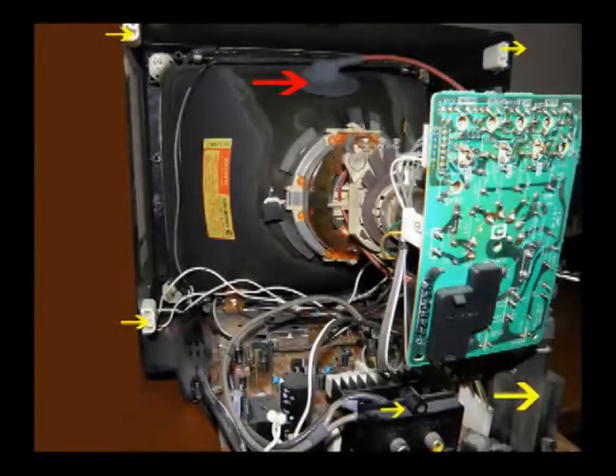In this photo, the small yellow arrows show where the five screws that hold the back case go, and the large yellow arrow shows the transformer, and the large red arrow shows the high tension cable that goes to the tube. For safety's sake, you need to discharge this, and you can Google how to do that if you're going to be in contact with it. I was careful to avoid this area, so I didn't discharge the capacitors. Be aware that that's very high voltage — high voltage will be present even with this television unplugged, so be very careful.